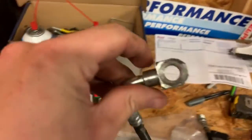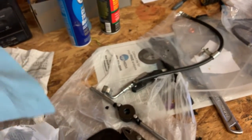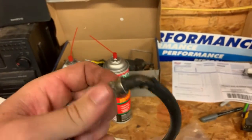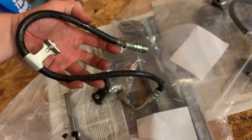That is why I had to cut the corners off. I don't know what the deal is — everything online: Summit, RockAuto, O'Reilly's, Advanced Auto, AutoZone — all say that this brake line should bolt onto those calipers, but it doesn't. I'm not sure what the deal is with that. What this one did — and this is a two-year-old brake line — the rubber completely failed because the brake line was sitting just kind of scrunched up, something like that, because this brake line is way too long.